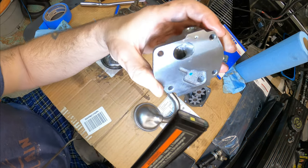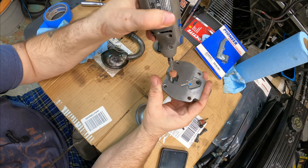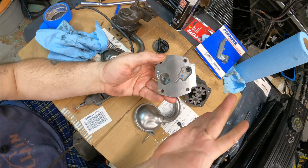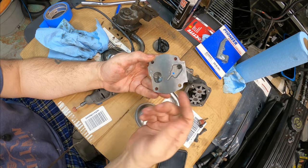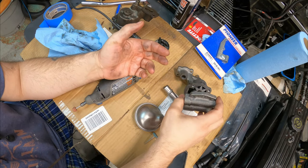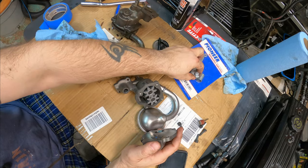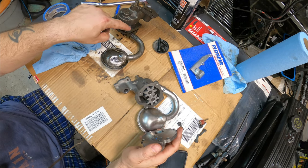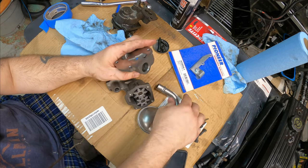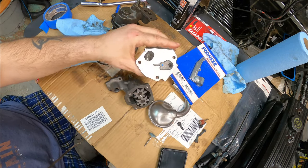You can see how I cleaned it up in there with basic Dremel tools — very simple, very easy. I came in and cleaned up all the casting marks right up into here, which dramatically increases the flow of the stock pump and decreases the resistance coming into the pump. That right there is a mandatory mod for any small block Chevy oil pump you install. I prefer using this retainer over welding because welding steel to cast iron is a crapshoot unless you know exactly what you're doing — I've done tack welds before that moved on me. This is easy insurance. Hope this helps somebody.